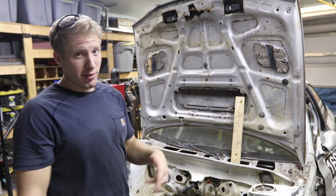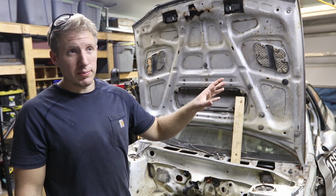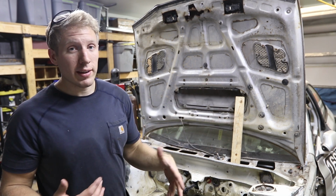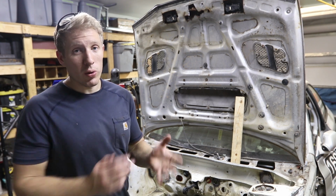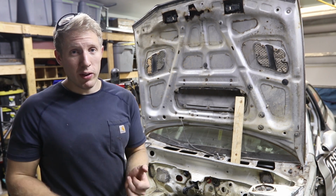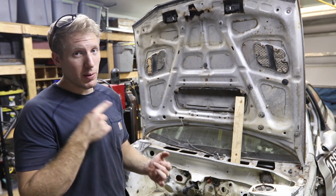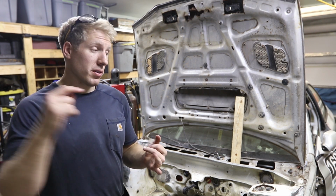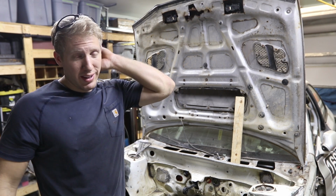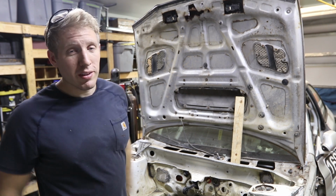Definitely recommend that if you have this type of a Subaru. Pretty much all the Subarus like this, like older ones, run through the wheel well, so it's definitely worth relocating it, especially because it's not that hard of a mod. The horror stories that I've heard from this stuff failing, from costing them the whole rally from it getting ruined right away, I mean, that's super expensive to get a DNF from something that can easily be prevented. The new harness that you're gonna have to buy when it ruins it, the stuff it's gonna fry, it's just not worth it. I mean, it could start a fire and burn your whole car down, stuff like that.